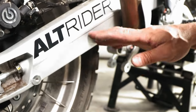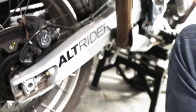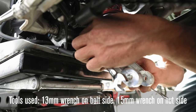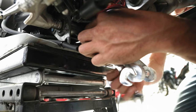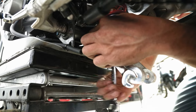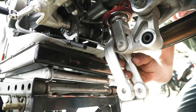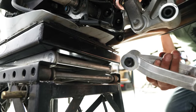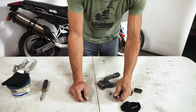Because the wheel is on there I have enough friction to hold the bolt, but it's really hard to push out. The tip is to get your toe underneath to take a little load off, then push the bolt out. Now the front pivot bolt won't have any issue because there's no load on it. Of course we're reusing those pivot bolts — we'll clean and grease them. I'll need to hold the other side as the bolt turns, so I use the 13 on the head, finish taking off the nylock, and walk the bolt all the way out.